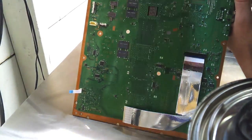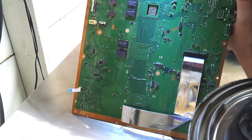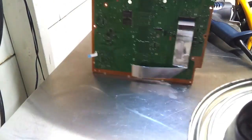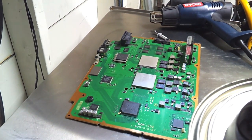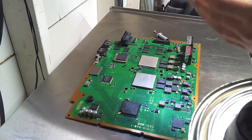I also don't want to buy a new $200-$300 PS3, so it's time for the fun part — use the heat gun. We need it at about 750 degrees Fahrenheit. Mine only goes between 500 and 800, so I'll turn it a few clicks under 800 and wait for it to warm up.